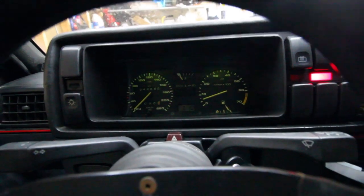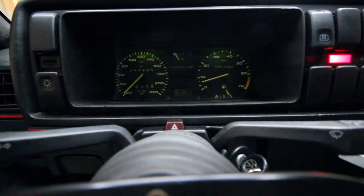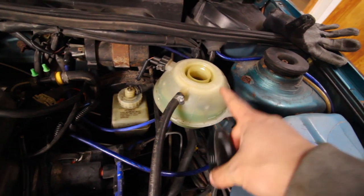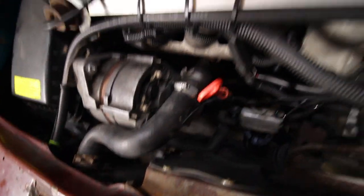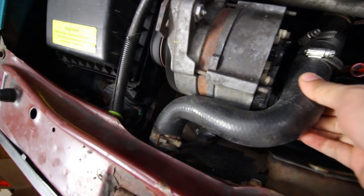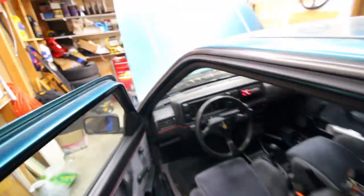Let's go ahead and try to solve the coolant fan issue. Car started — it looks to be slowly building temp. Let's start massaging the radiator hoses and slowly open the overflow cap to see if we can get the coolant fan to kick in. While I slowly opened the lid, I did hear some air come out. I started massaging both hoses — right now the bottom one is cold, so the thermostat isn't opening yet. The top hose is hot. Once the needle goes past midway, we'll reassess.